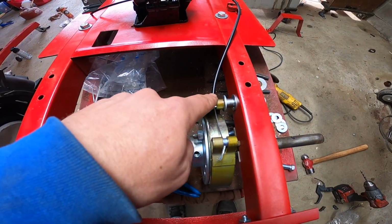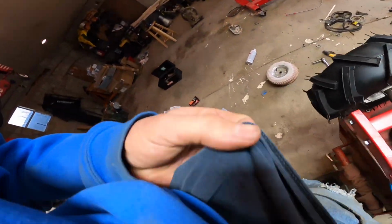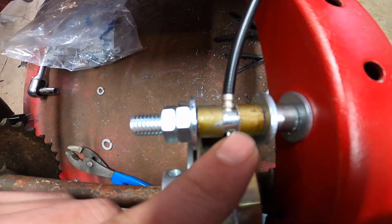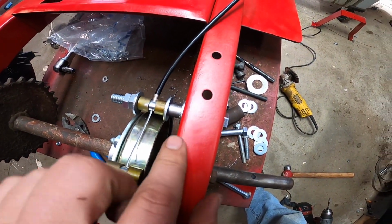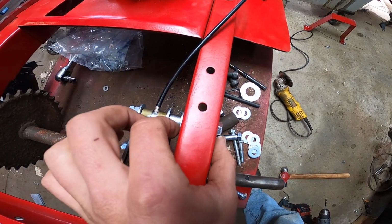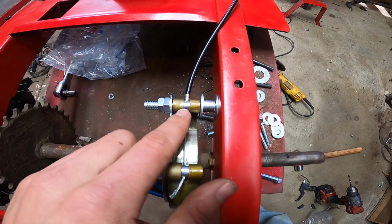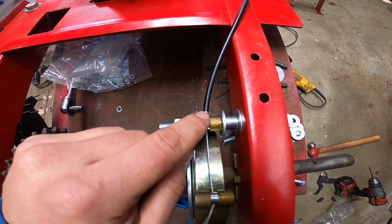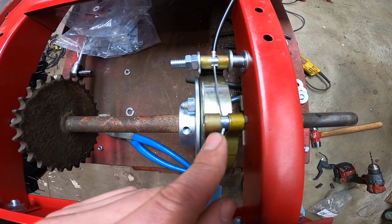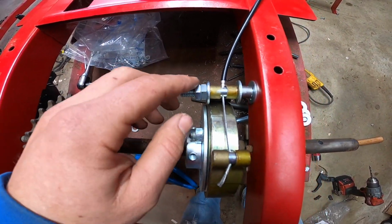So what we ended up doing here is, this is just a bike brake line, and I took this bolt here, drilled it through the frame, and there's actually a bushing up underneath. That bushing is so when I squeeze this together, it does not squeeze the frame, because it's open on the bottom. It doesn't pinch the frame. All I did on this bolt was drill a hole for the cable, and then one size bigger for the outside of the cable to sit in. And obviously this has the hole down for the wire, and then I just have 2 backing nuts in here.